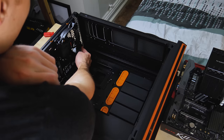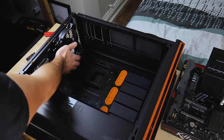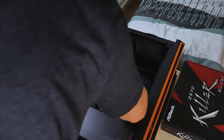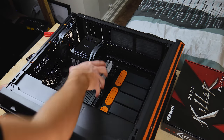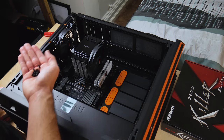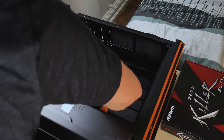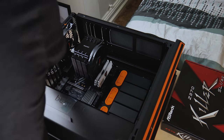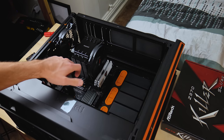Come on, pop in. Just do it. I got them in. Now we're just going to lower this in. This board does have weird dimensions — it's not like a full ATX, not micro ATX. It has a thinner profile than regular ATX boards. I believe these are the motherboard screws. That doesn't feel like a motherboard screw — I'm guessing these are the motherboard screws. What I like to do is get the corners in first.